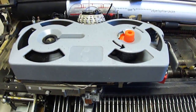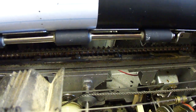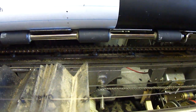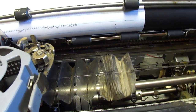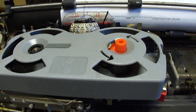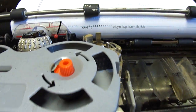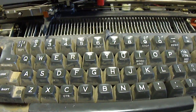I've fixed a lot of problems in this but it's still not perfect. It's got a worm gear back here that moves the carrier along, rather than the standard way it does in a regular Selectric. The thing that couples the carrier to the worm gear had jammed because of sticky grease, so the carrier wouldn't stay in place. I've lubricated it, and I've got it mostly working, except sometimes it doesn't type the right characters. I think it may be due to a problem in the solenoid bank — maybe loose connections or something.